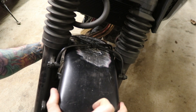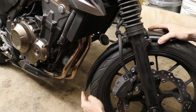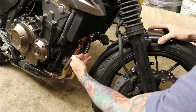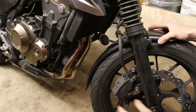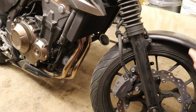And that's basically what happened. So today what I want to do is redo this and add another piece of quarter-inch rod that runs down the center of the fender, down the back here, and basically comes off the fender and comes up to reinforce this whole section down here — really solidifies all this stuff so that we don't have this ability for the thing to wobble like that.